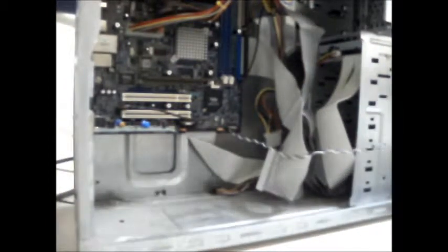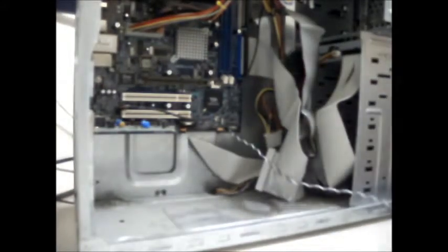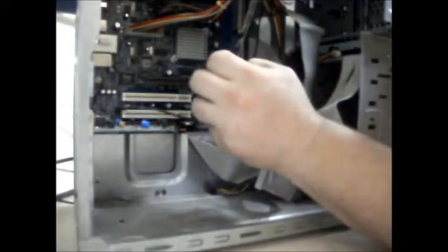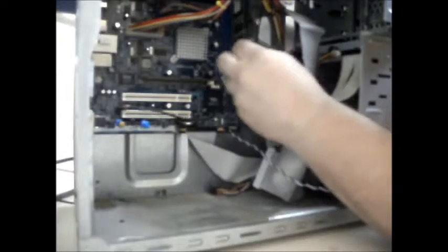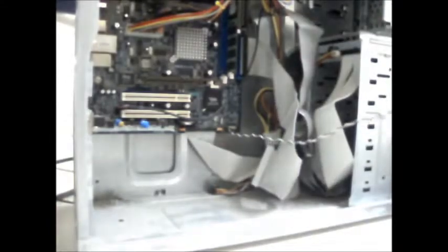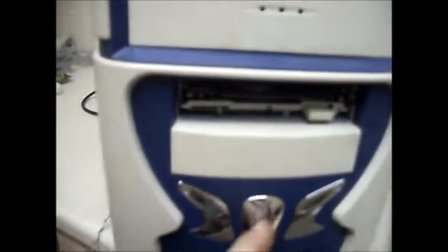Power on. Nope, not power on. It's not going to operate without any RAM in it, is it? That one's rather dusty, so I'm not going to stick it in that one — I'll stick it in a clean one. There we go. That's why it's rather dusty in there. Power on. Turn on. Hold on there — it's actually rather quiet. So I bet that's the problem with this one, that the button's broke. Because there's no click whatsoever there. I can't even feel a button. So I'm guessing that's why it was all disconnected — maybe the front panel's gone.